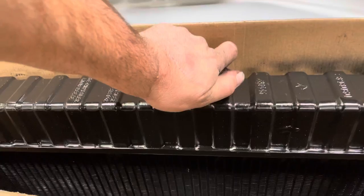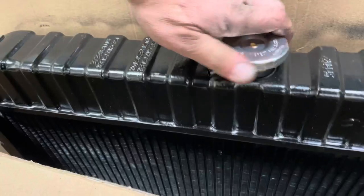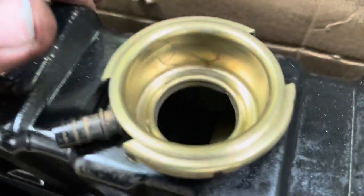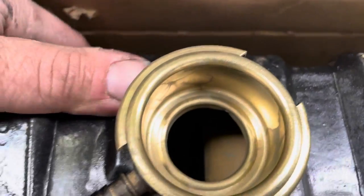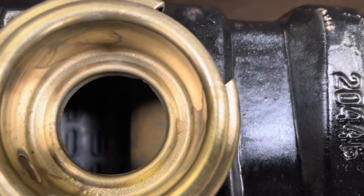Look at the radiator back from our friends at Bob's Radiator — this has been cored with a high efficiency core. Got a fresh cap for it too, that cap is snug. Reminds me, I need to get an update for this too. Now we have three killer rows, high efficiency, as opposed to the factory two row that this radiator was.